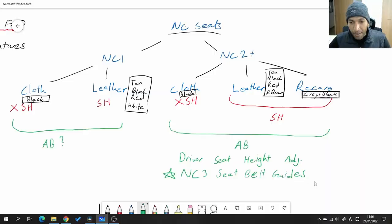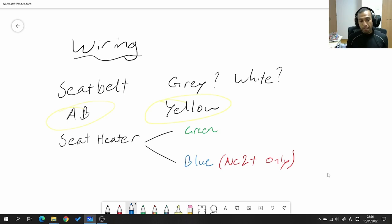Now let's talk about the wiring. Underneath your seat you're going to find one big white connector block with a bunch of wires going into it. On one side that white block is attached to your seat; on the other side it's connected to wires feeding up from underneath the carpet below the seat — that's the vehicle side versus the seat side. On the back of the seat-side connector you'll notice a bunch of smaller connectors slotted in, all color-coded.